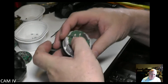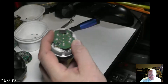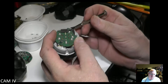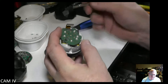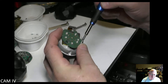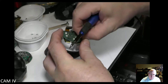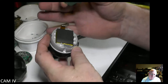This does have a ribbon cable connector, just as the 360FLY HD has, and it's the same process. Give it a little bit of pressure underneath and the ribbon cable will disconnect. Once you've done that you've got four screws that would hold this in place. Again, everything is T4 spline type screws, not the Phillips head. That board comes up very nicely.